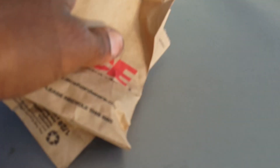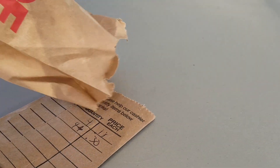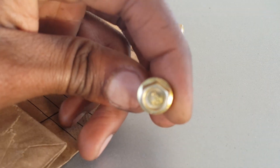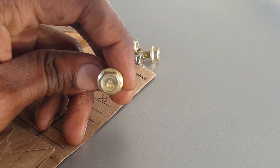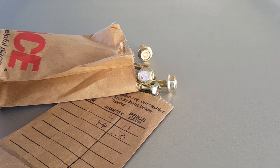I went to Ace Hardware and ordered some stronger bolts. The broken one that came out — I'm not sure what strength it was — but the originals are 8.8s. I decided to get some 10.9s, so should be all good to button everything back up.